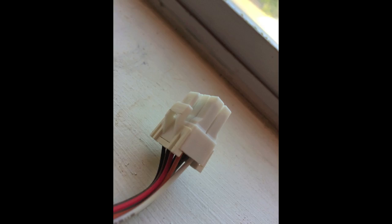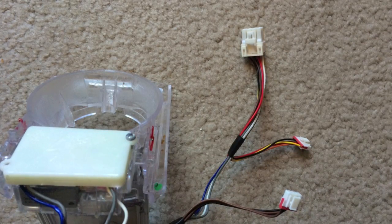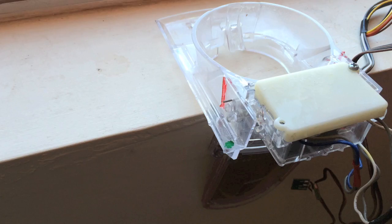Now there is one connector that needs to be unplugged to remove the display unit with paddle assembly. I pressed on the tab to the left to free the connector. I had to look at the new unit to get a better understanding of the tab that holds it in and where the connector comes apart. I had to remove the two cables coming from the paddle insert. A sketch may help in reassembly.